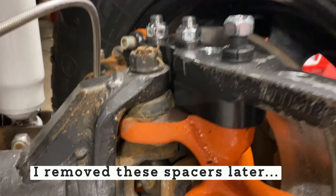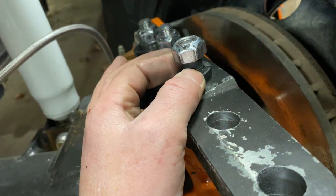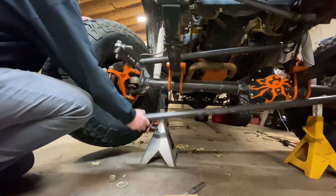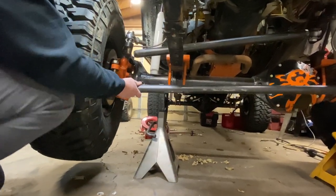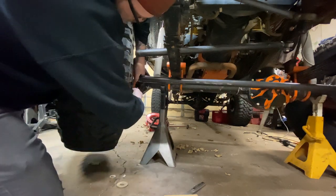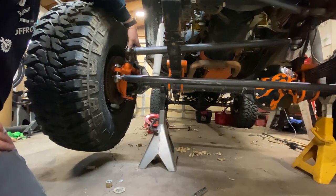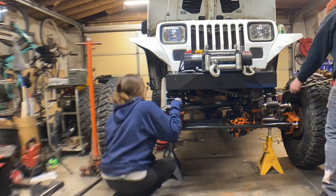My arm's got these spacers so I have special long studs, and two of them are fouled out - I need to replace those two. For now it's held on solid with two. I'm gonna lightly put this back on there so I have an approximate location of the tires and can measure for the new tie rod. This will get me in the ballpark - set those joints up here in this hole on each side, put the nut where we want it, and tape measure across it.